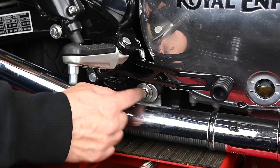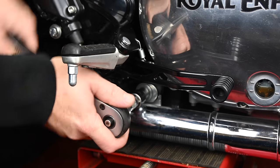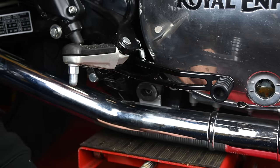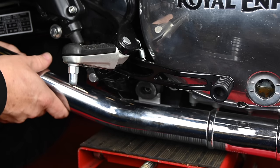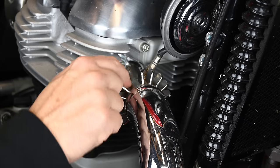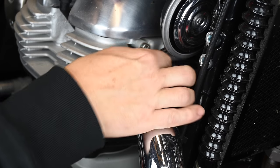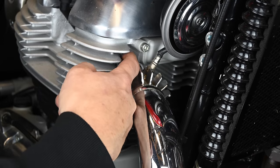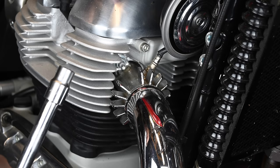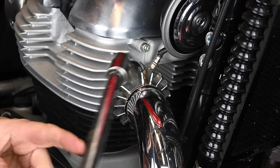Next is the mid mount — this is where the main exhaust will be mounted when we put the new one on. It's a 12mm bolt that can come out, along with the top hat. Once nothing is fixed, we get up to the front end. There's an O2 sensor to take out to put into the new one. With these fins it's easier to take the header off so you can move it down to access the sensor from the other side, as it's really difficult otherwise. The header nut is another 12mm bolt — really easy to work on with Royal Enfield. I've just got a longer reach arm to get to it.